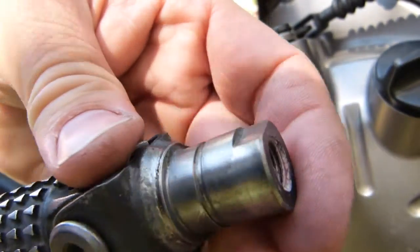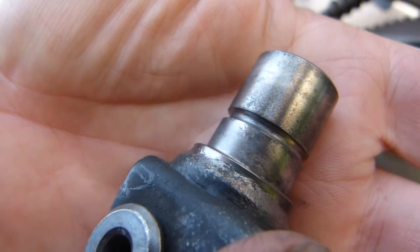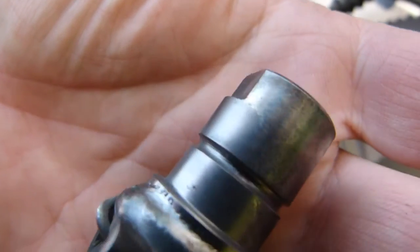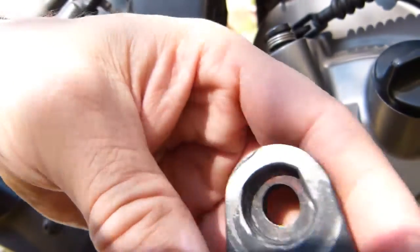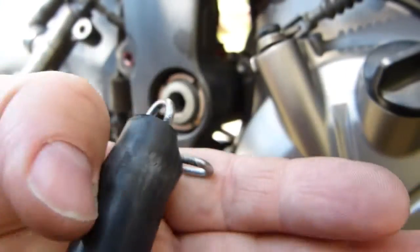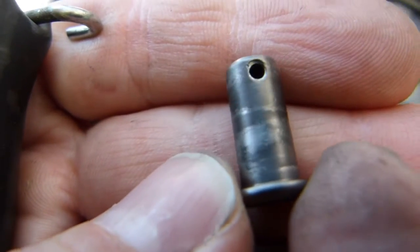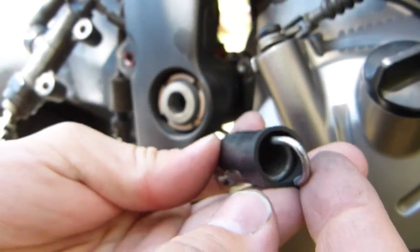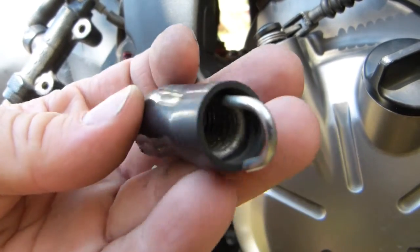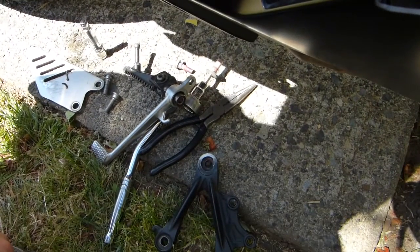Now the bad news — let's look at the corrosion. This was cleaned up with a wire wheel. This is a steel component and you can see some corrosion from past winters — that's normal. That amount of pitting is what one would expect. This one is more problematic. This small pin was also cleaned together with the spring — corrosion and wear is evident, but no deep gouging, so it can go back. Spring is good — I just cleaned the hook on a wire wheel. I'll try to improve this design and come up with something that works a little better.